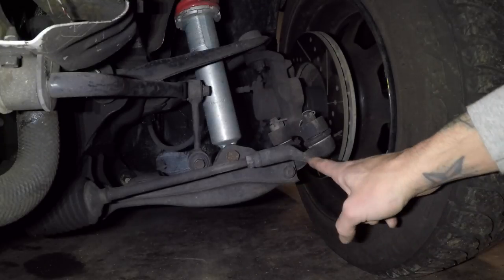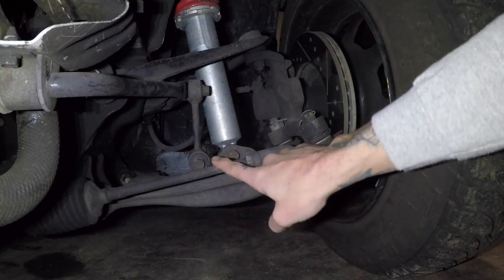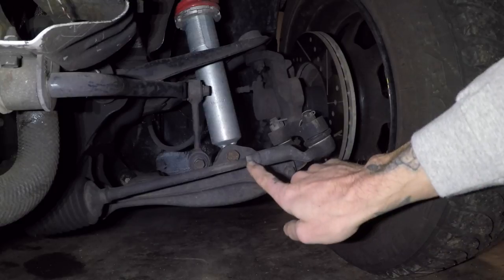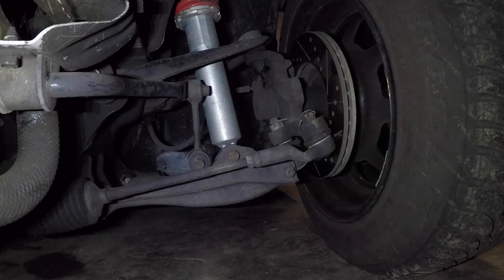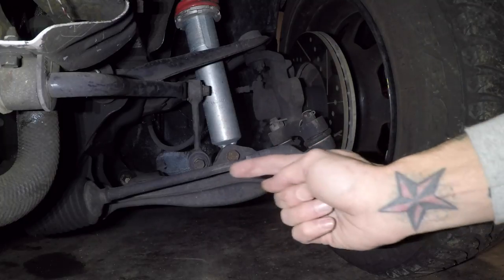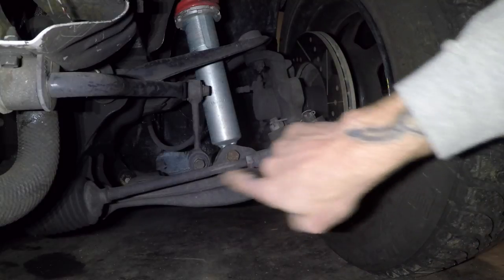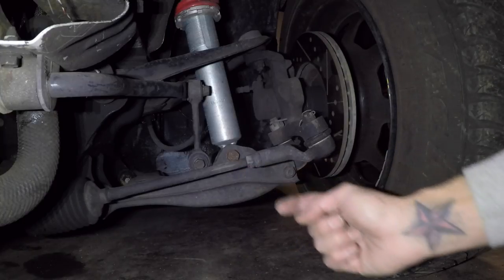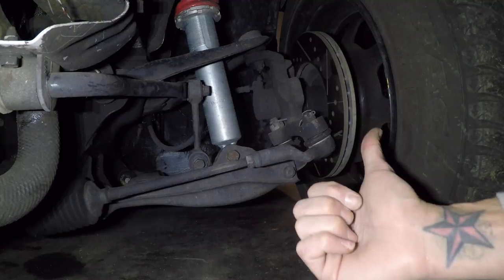Now as you can see here: the outer tie rod end, the inner tie rod end, and the adjusting arm. Sometimes the inner and the adjuster are one piece — like on this setup here, if you replace the inner tie rod end the adjuster comes with it. Essentially what I've got to do is break this nut loose and then turn this notched piece here a half a turn to bring the wheel in further — screwing this in, pushing it that way a half turn. When I dragged the curb a little bit it obviously pulled this out, so this needs to come in more because I'm having to turn the wheel to compensate for the tire being pointed out too far.